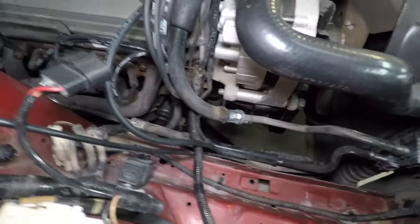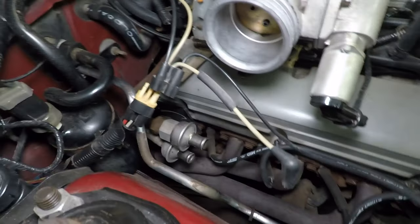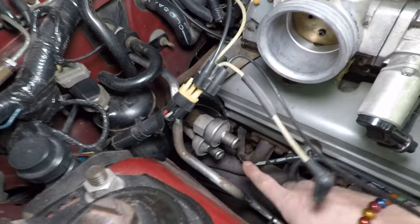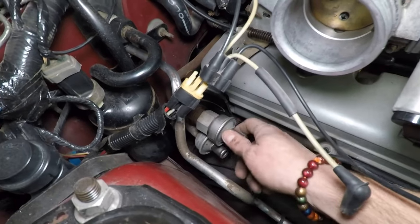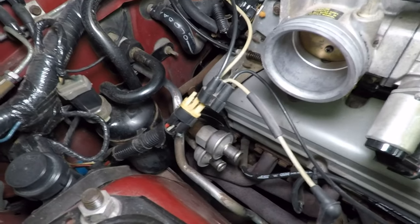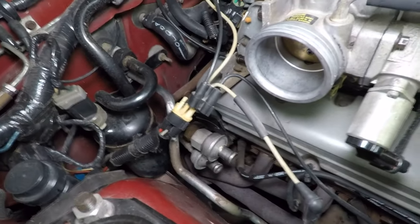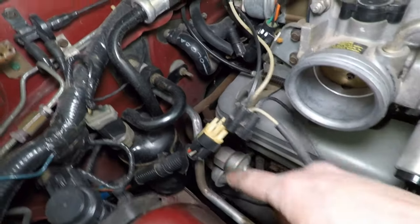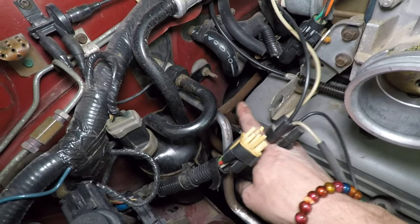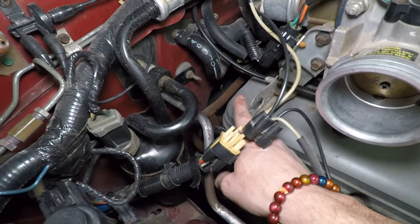As far as next steps go, I've pretty much done everything up to here. If you don't have the other bits and pieces I'm about to install, you can stop here — you'd just need to block these ports off with a piece of hose and a big bolt. I ran my 92 green coupe for years like that, just plugged both of them off. But this rusted steel hose here goes into the back of your cylinder head, and if you're pulling the whole plumbing situation out, you've got to block off the holes that go into the back of the cylinder heads.